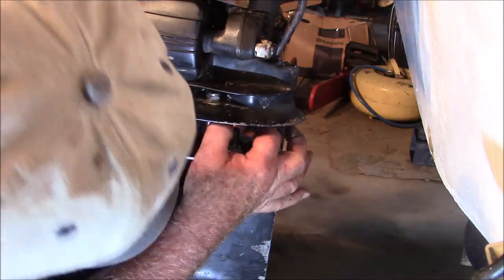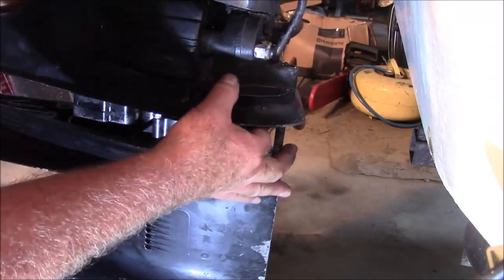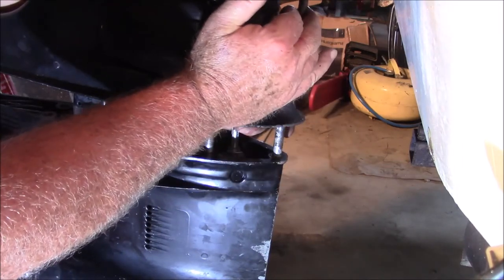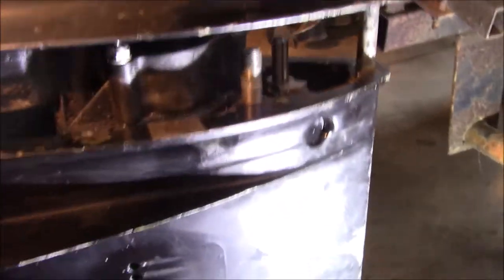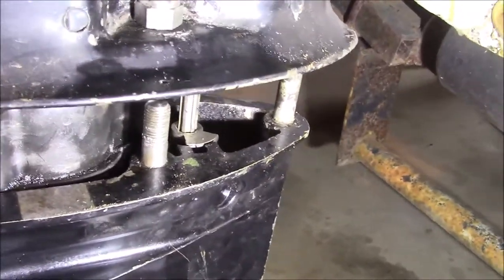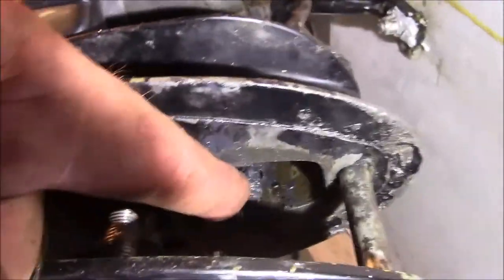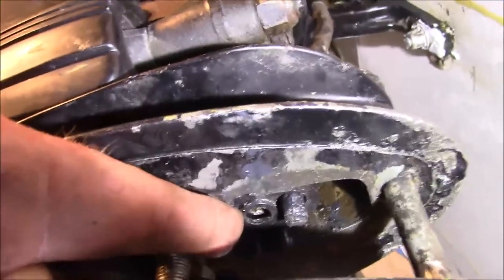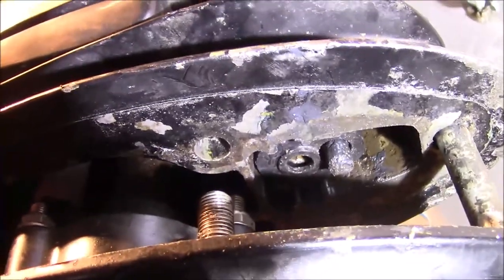And I think they call it an alignment bushing. And they call it an alignment bushing for a reason. Because if you do not have it properly, there's just no way that you're gonna get this lower unit together. You can see the cam. See it down there? Where it's positioned. And then if you look up, you can see the alignment bushing where that comes through the forward hole and then the spline for the shift shaft is right there.